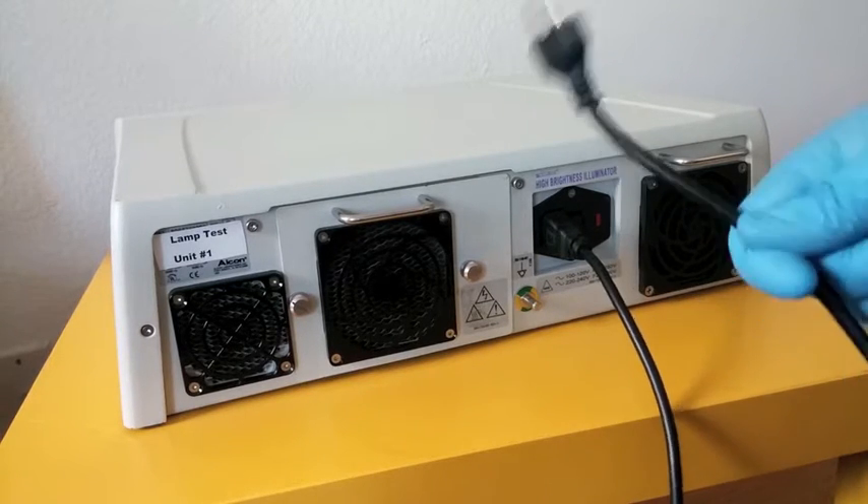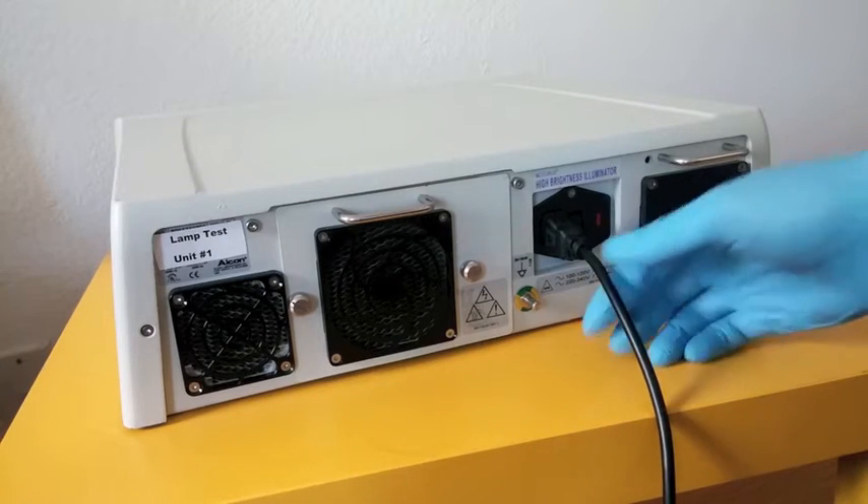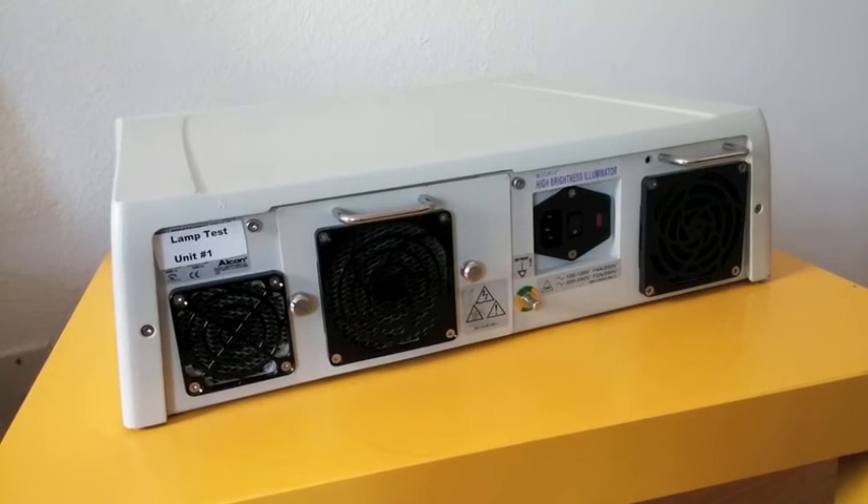So now it is unplugged, and I also go ahead and unplug it from the system as well, to be completely confident that the system is off. Because the lamp was operating, it is hot. The manual recommends waiting for 5 minutes before going inside and retrieving the lamp module. So I will stop the video at this point, and in the next part of the video we will go further.